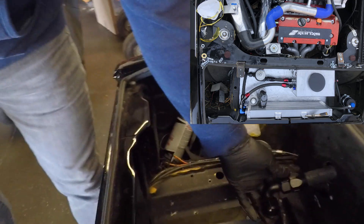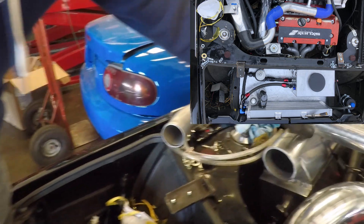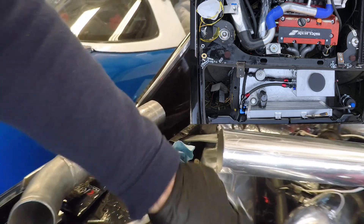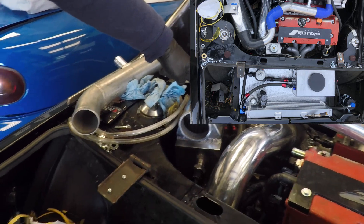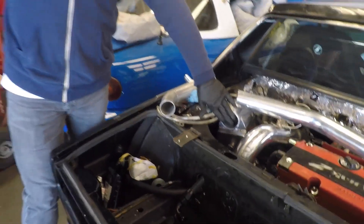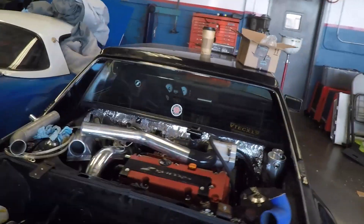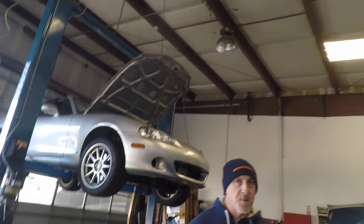The way you're cooling this is with an air-to-water intercooler versus just an air-to-air. These two lines are going to run cold water from an ice box and a radiator, essentially — gets pumped into the intercooler and flows back around, giving it a constant cooling of the air. I ran one of these on the other car but it was much smaller, so I couldn't get the temps too far below ambient — somewhere like 10 degrees above ambient, which always seemed a little high. With this setup it'll be much, much cooler. The cooler the better for intake charge temperature.